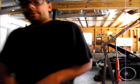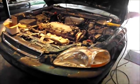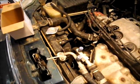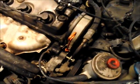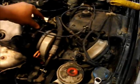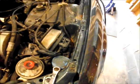Now, the first thing you want to do, and anyway, this is a '98 Honda Civic. It's got 108,000 miles on it, and it loses water, but it doesn't leak water. I narrowed it down that the coolant fan was not coming on, and if you pull the stick out, it doesn't have oil in the water, but if you pull the cap off, and I'm not sure if you can actually see this, there is condensation in there. So, I was like, what the hell, I'll go ahead and do it. I'll be able to make a video, maybe help some people out.